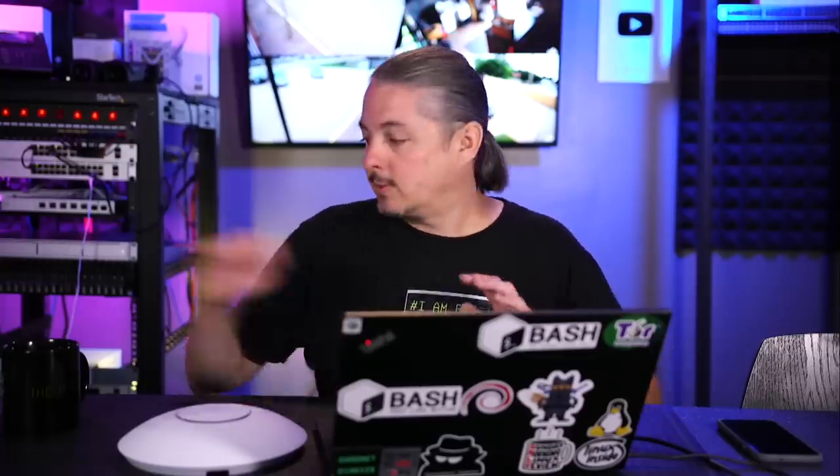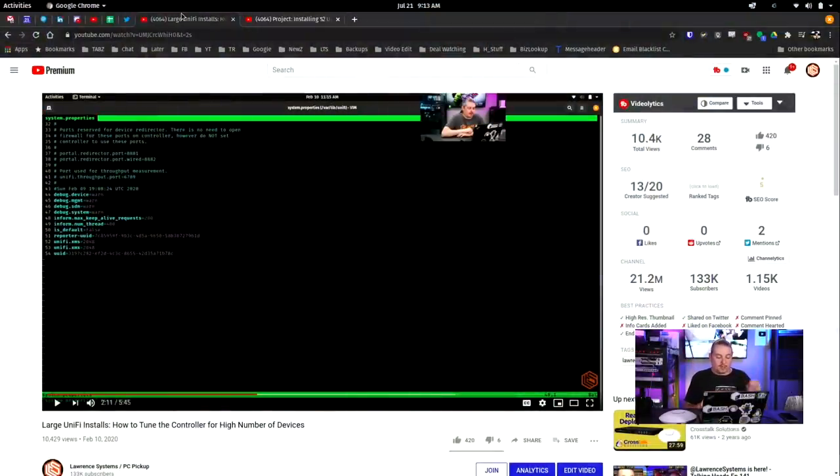What do they look like now? This was December of 2018 — what do they look like in July of 2020? Have they survived firmware updates, controller updates, et cetera? One important thing: make sure you have the controller tuned for a high number of devices. The only thing they've had to do is add more memory. Their internal IT team has been good about keeping the controller up-to-date. They bumped it up recently to 16 gigs of RAM and it solved some quirkiness with the dashboard. The users are thrilled — they work. They haven't had any hang-ups or hiccups. We haven't even been out to swap a single one.